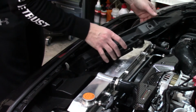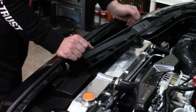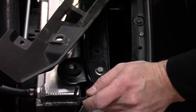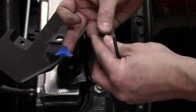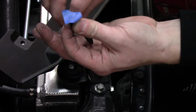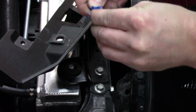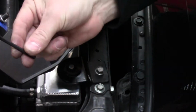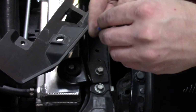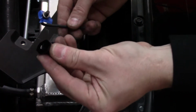So with this kind of bent out of the way and not putting too much stress on it, we're gonna grab our screw and our little fastener piece, and we're gonna go ahead and attach that. All right, for this part, the only way that I'm thinking is gonna work is we're gonna use a little bit of masking tape like I typically do to hold things into tight locations, place it on top of the button head cap screw here, or bolt, and seat this as well as we can on the angled portion of the Allen key they provided, and we're gonna try to fish this up under without losing it in the car. So make sure you have your aluminum piece ready to go.